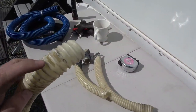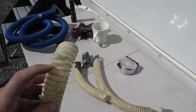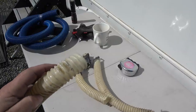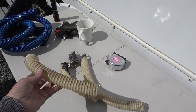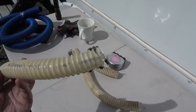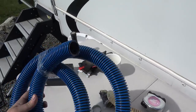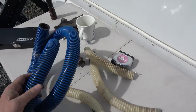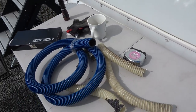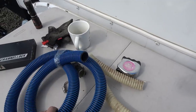Got her all out, and there is my leak — there are a couple of slots. Unfortunately that looks like maybe a rodent was in there gnawing on it, so I'm going to have to have a really good look around the underbelly to make sure it hasn't done any other damage. This stuff you can get from RV dealers, but the local RV company didn't have it — it's just flexible PVC, one and a quarter inch. So I hit Home Depot and got what's called pool and spa hose, which is exactly the same size. You want the flexible kind because it goes around corners. We don't drink out of our freshwater tanks, so I'm not really worried about whether it's food-safe — it's just a gravity fill hose.